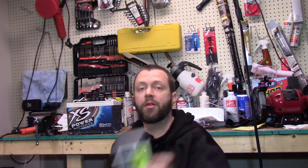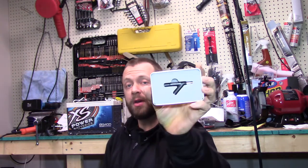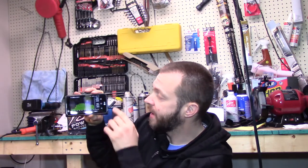Now in order to tune this speaker properly, the best thing I could do would be to put in a digital signal processor. I think that's coming up because they're coming down in price. But I'm going to tune the system the best I can with what I have. The head unit has its own internal equalizer, and in addition to that the subwoofer amplifier has a parametric equalizer. So between both of those, I can use both my ear and an RTA microphone to help tune it. With this microphone I can get the system pretty well tuned — it works with an app on my smartphone and is a very budget way to tune your system. This allows me to put on a pink noise and try to get that as flat as I can by adjusting the equalizer on the head unit and the parametric equalizer on the bass amp.